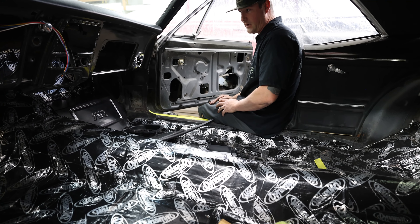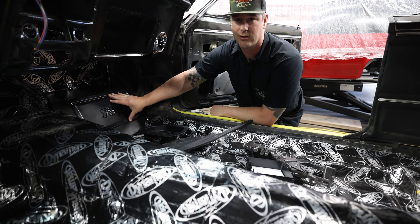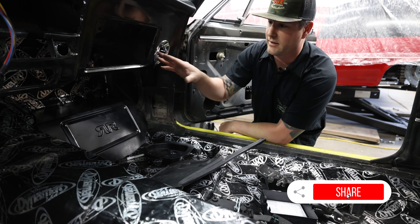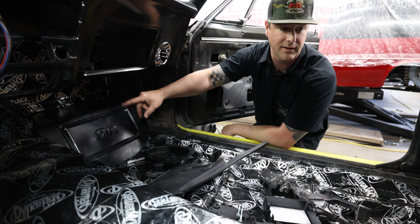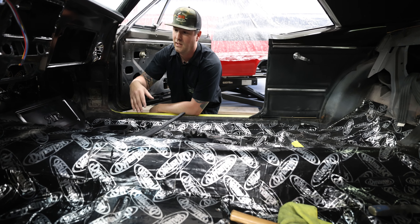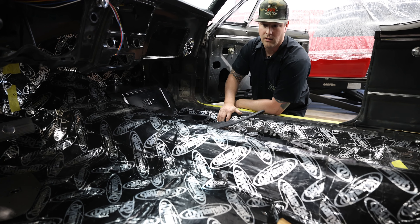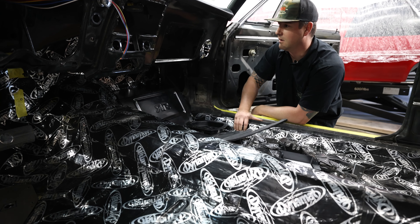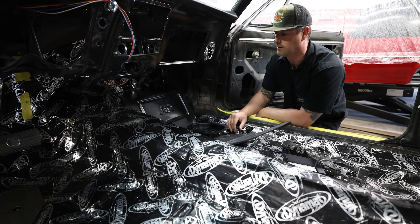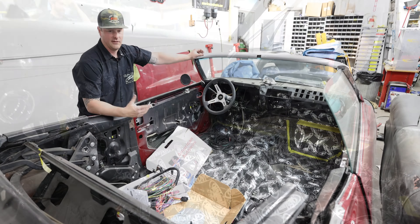We are now inside John's '67 Camaro where the Dynamat tour continues. You can see we did the whole thing from back to front, up the firewall. We built an ECM cover that houses all the engine and transmission controller modules, and the Vintage Air will sit right above it. We'll run it all the way up and it'll be behind everything, keeping it nice and sealed. On this particular car we put all new floor pans in, the tunnel got epoxy seam sealed, all the metal sealed up, and then we covered it with Dynamat too. We also put it inside the doors — it made a world of difference when you shut them, just nice and solid.